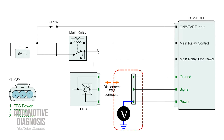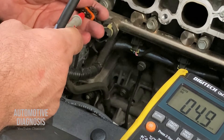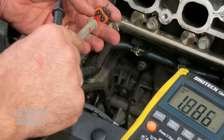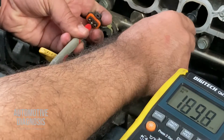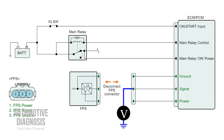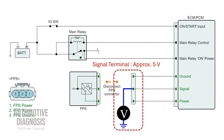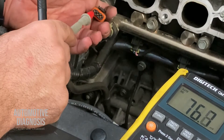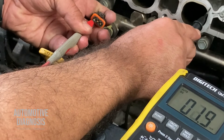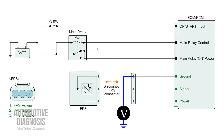If you are getting five volts it means your power supply is okay. The second check is the signal wire — I'm checking the voltage on the middle wire and body ground, and I should get five volts here as well. For the last wire, the brown ground wire, there shouldn't be any voltage. As you can see it's just millivolts — essentially nothing.